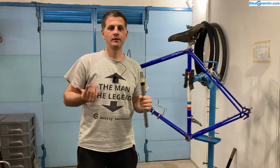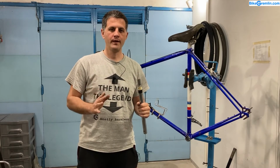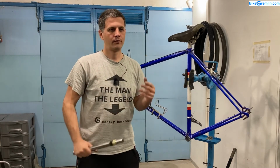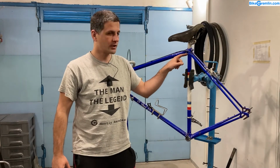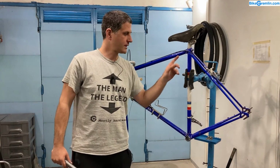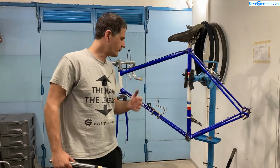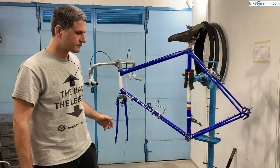Any kind of metal, titanium, steel, aluminium, is generally okay, because even if it starts cracking, even if it turns out the frame is not strong enough for you, for metal frames the cracks will appear on the outside, usually near the joints, depending on how the welds are made. But that's where they usually appear, like thin hairline cracks, sometimes even on other sections, but you will notice them. With forks they usually start at the rear end, here.